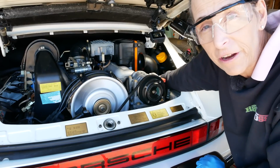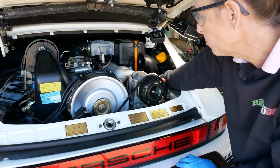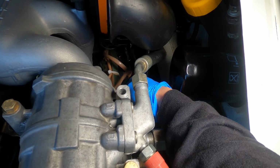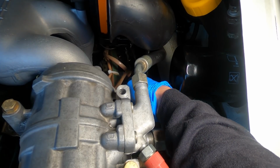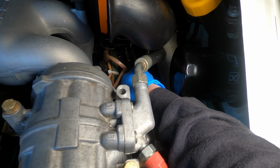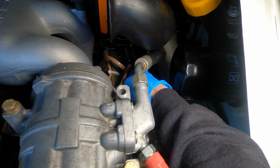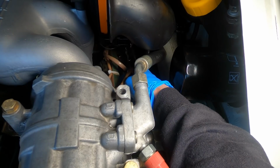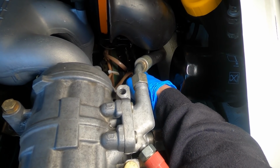I have to be very, very careful. We've got a lot of rotating bits here and just have to be super careful of that. Okay, let me see if I can pull this. These connectors are a little hard to get off. But let me see if I can pull this one on cylinder number 4. There it goes. Okay, so do you hear the idle drop? It dropped down probably, I don't know, 300 or 400 RPM. I'll plug it back in, and the idle goes back up.